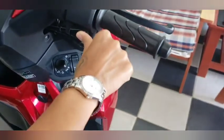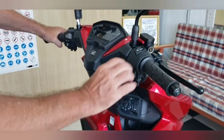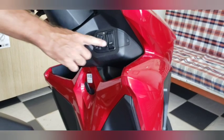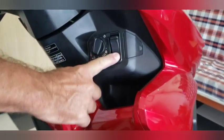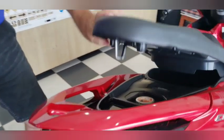From the actively displaying speedometer, a single click to the left takes you to the position for opening the helmet compartment under the seat with the fuel tank. Then press the bottom right toggle switch labeled 'seat'. Larger models also have the inscription 'fuel' on the top of the toggle switch and an external tank cap.